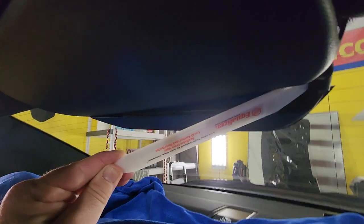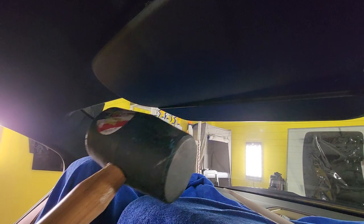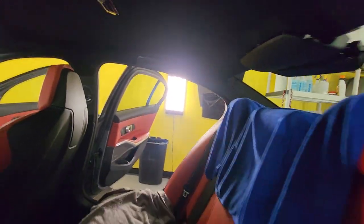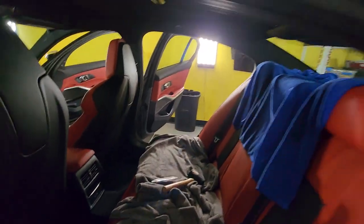Sometimes you just really can't get it off of there. So what I do is I use my little white tool and put it on the edge right on that button. Then I take my little rubber mallet and just barely tap that little plastic stick. Obviously you want to use plastic on everything — the last thing you want to do is use metal and break a back window. We always put towels down as well. Now I can get behind the brake light so it's going to look nice and clean, done in one piece.